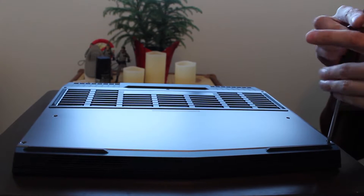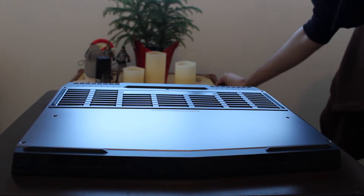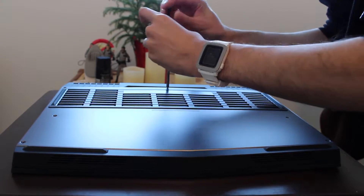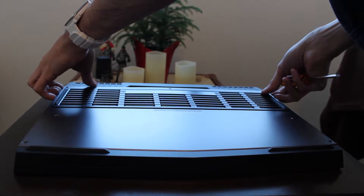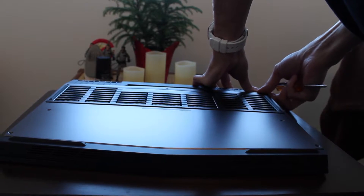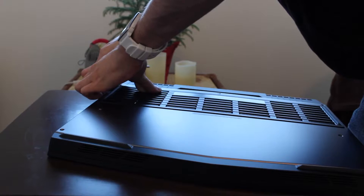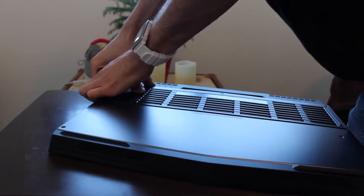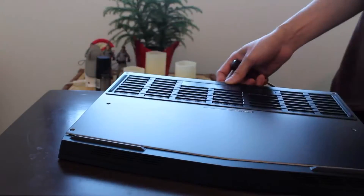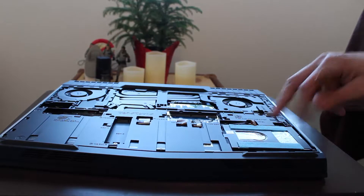What I like about Alienware and their laptops is they have things easily accessible. It's a couple screws and you're in your unit. This top screw is the one that bothers me the most — I actually can't get it out ever. So go ahead and pull out your case with a little bit of force and some grip. Remove the case, the back panel.